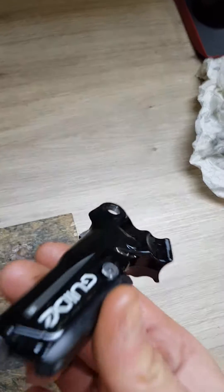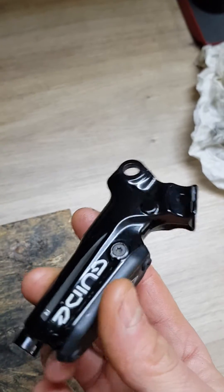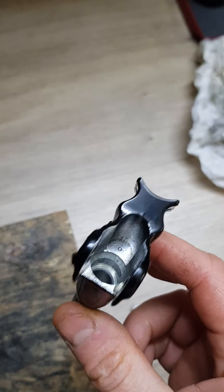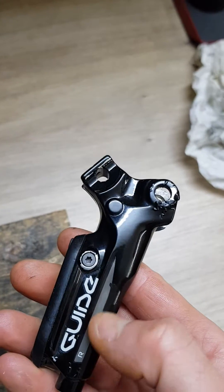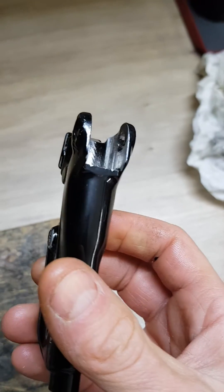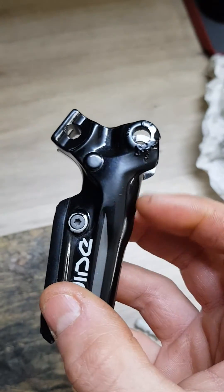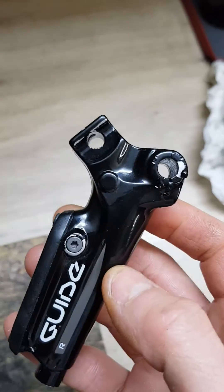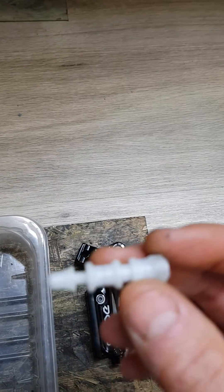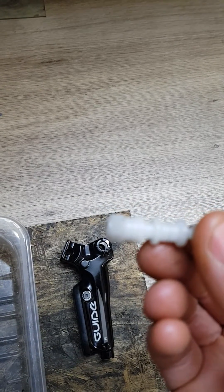This is actually a brand new right brake lever for the rear brake. During the die cast, it seems they have a lot of impurities in the aluminum alloy material. When they do the drill in here for the piston bore, on the wall inside you could see big craters, also some impurities inside which are very hard, and of course it's damaging the original piston, which is made from plastic, which is ridiculous in my opinion. It's severely damaged and it jammed.